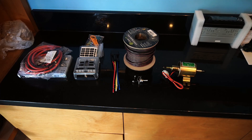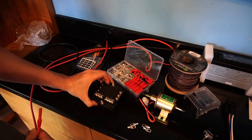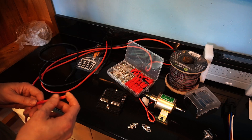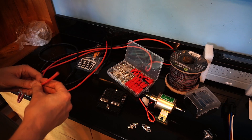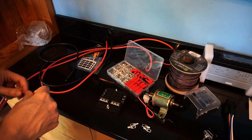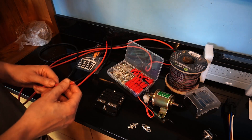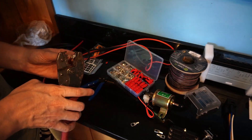Run a lead from the battery to the fuse box - I'm using 8 gauge. I don't have that far to go and I'm not powering stuff that's drawing that many amps, so I think over the distance I'm covering this will pull around 60 amps fairly easily. The biggest draw is the stereo at 15 amps; I've got a couple of lights and a fan and it's not going to pull anywhere near that much. The distance is pretty short for a DC circuit. We're going to crimp on the big yellow terminal.